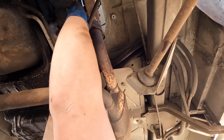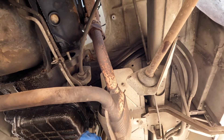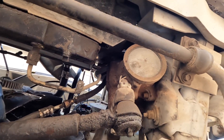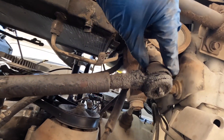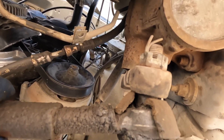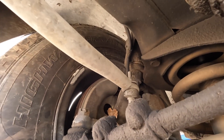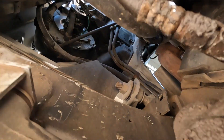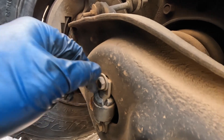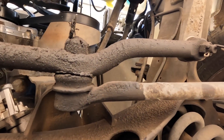There's the starter — I'm going to set it on the cross member so there's no stress on the cables. One thing I noticed: check out the steering linkage — you think the steering might be a little sloppy? That's the worst ball joint I've seen! Let's look at some of the other bushings. Tie rod ends could do with replacing. Control bushings actually don't look horrible — slight cracking but you'd expect that. Shock bushings — maybe putting some new shocks in this thing. Everything else feels pretty tight.